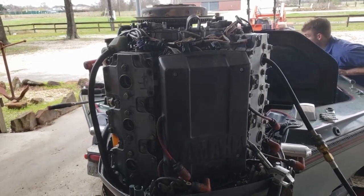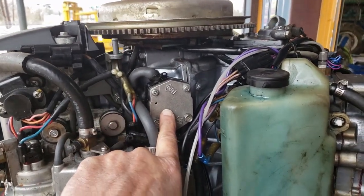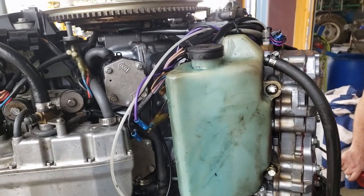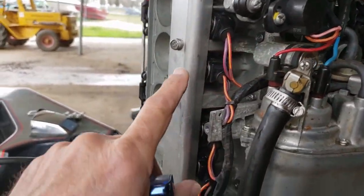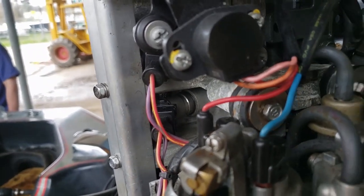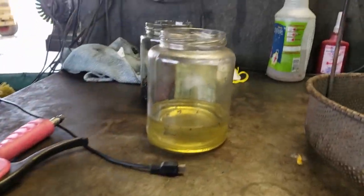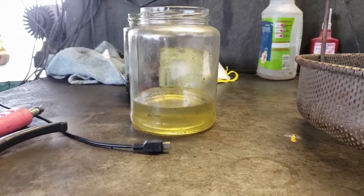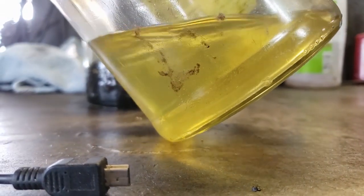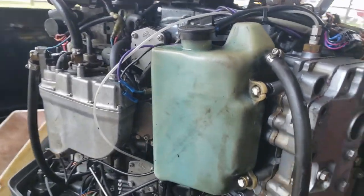It's perplexing as to why number two is the only damaged cylinder. To me that indicates potentially the brand new fuel pump is blown and drawing vacuum into that cylinder causing a vacuum leak — I don't think so, but it's possible. More likely, maybe the boat has been sitting and this fuel injector right here could be clogged. We did take a fuel sample and the fuel looks a little gold-colored. Yesterday's fuels were gold; today's are clear. So gold fuel has some time on it, but the biggest thing is we don't see any water in it.